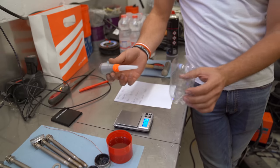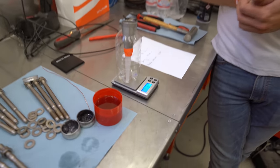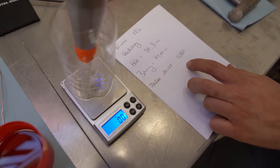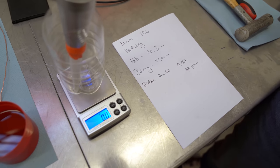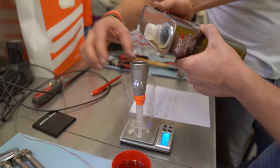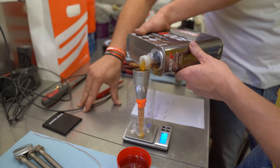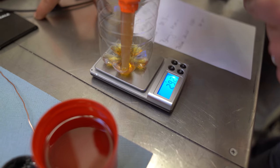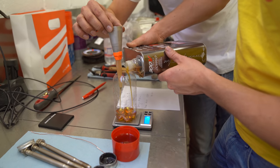Since we need both of these containers to pour the oil in, I'd say let's zero our highly precise scale. We got the density from the Motul website. That means for 100 milliliters we need 86.7 grams of this fine oil. Mr. Wehmeyer now needs to pour that in somehow. Look at how well it flows - or doesn't flow. We'll cut out a bit more here. You can always pour some in and I'll put it back. You can see there's already quite a lot here.